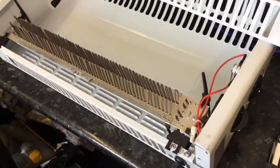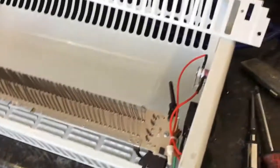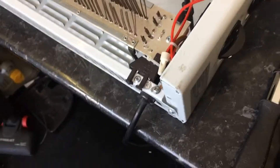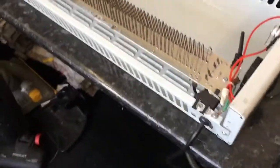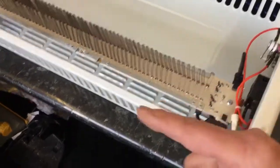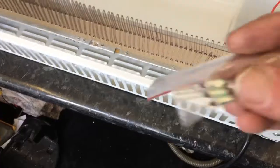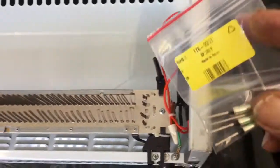The complaint with this was that she twisted it on and it worked okay for a while, then it cut out. My first thought was: where are the legs? She said she'd just stand it on the floor. You can't do that, because the heat comes out the top and it draws in cooler air at the bottom.